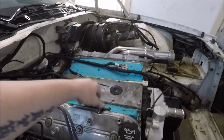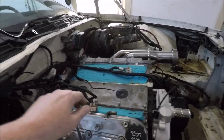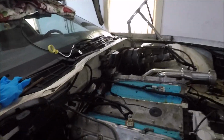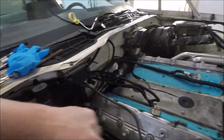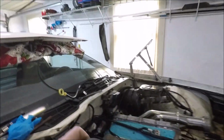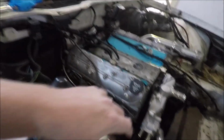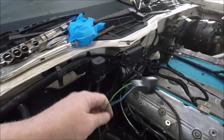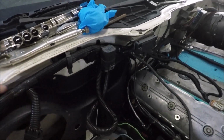Good. These are just for our 2 coil harnesses on either side of the engine. Our fuel injector harness plugs into that. We're not going to bother plugging that in until we put the intake on. Everything else is run here. This is for our wideband. This is going to go up here to the front somewhere, most likely. I got all this loomed up now, except for these 2 wires, which I still need to trace back and remove since we're not running AC.